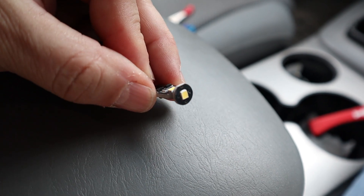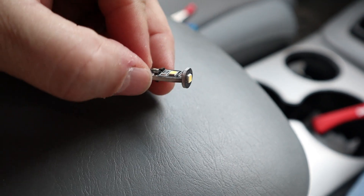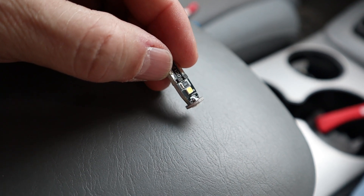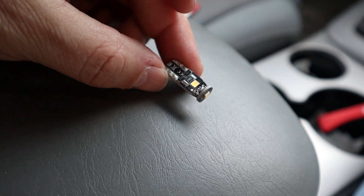These 194 bulbs are kind of interesting — they have three LEDs, one that shines straight down and one on either side, and it looks like they have some surface mount resistors to dissipate some of the power. Now that they're all installed, they illuminate the cabin pretty good. Some LED bulbs are obnoxiously bright and have a grayish blue tinge, but these don't really. I'll put a link in the description for what I purchased, and hopefully it works for you too. Thanks for watching.